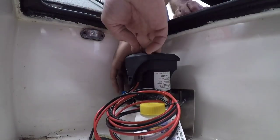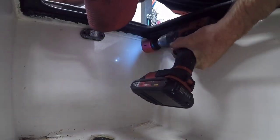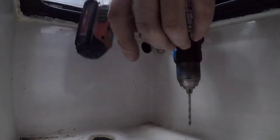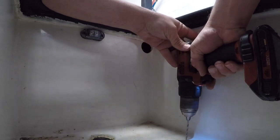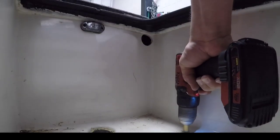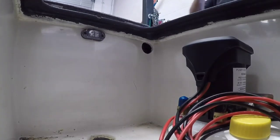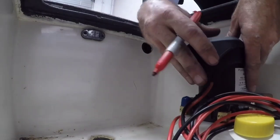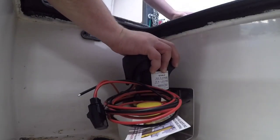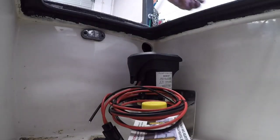We are making marks for four pilot holes and then using a hole saw to cut a hole for all the hydraulic lines and the wires themselves — four wires and four hoses for both hydraulic units. After the pilot holes were drilled, we polished them off with a countersink bit to ensure there was no further damage to the glass while we install these brackets. We dab silicone around each hole so that when we put the unit in and secure it, it will seal and no residual water will leak through the holes later.